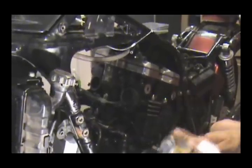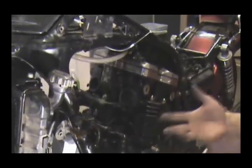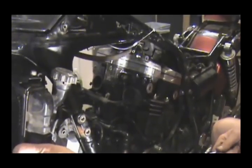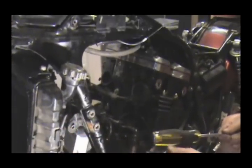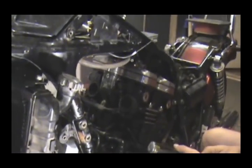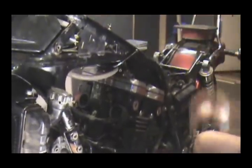So now down to the garage. Okay, as the other video very adequately showed how to take off the carburetors. Of course, the upper radiator, I've got the upper radiator disconnected. I don't have it taken off. Its mounting screw is still on there. I find that's easier for me. I use a short stubby screwdriver to get the heat shield off. Of course, you always got to stand on your head to disengage the throttle cables.